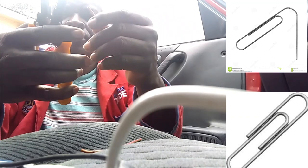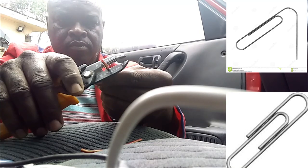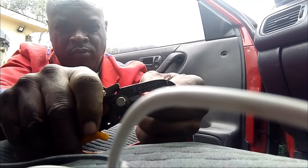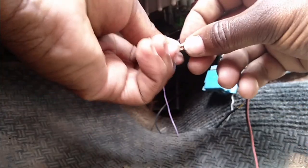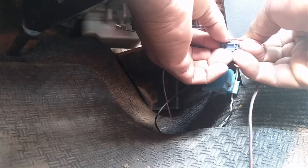That special tool will be an electrical wire which we shall use to jump the connector so that we can read the codes from the dashboard. You can also use a paper clip to jump the connector. The Honda CR-V has two connectors: one with three pins used specifically for the Honda code reader, and a two-pin connector which anyone can use to decode engine errors or ECU codes.